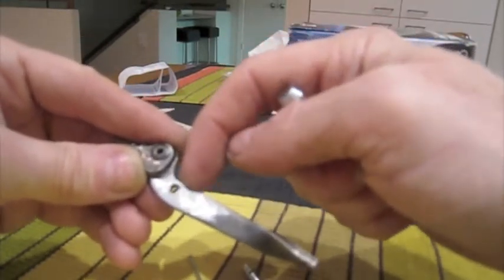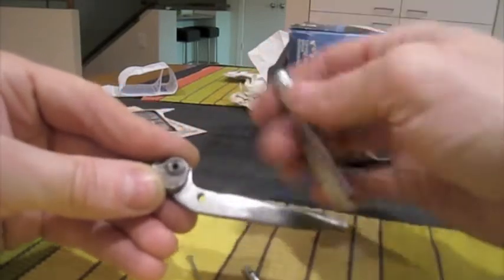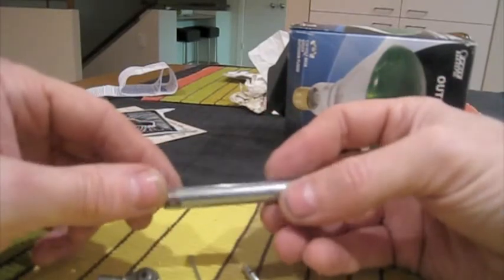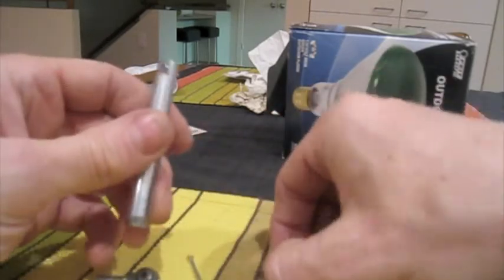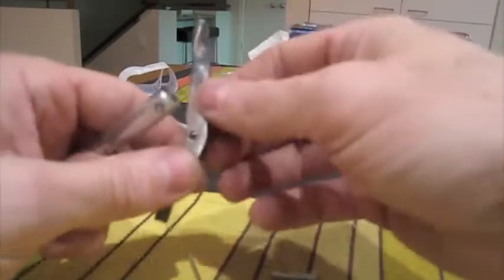I had that filled in at a welding shop. I cut a little piece of steel, had that filled in. I've drilled this hole out larger, and this is what I've started making the new plunger piece with. This is actually a linch pin. I think it's a 1/4 inch linch pin. And I cut this groove here, and this is going to replace that plunger unit.